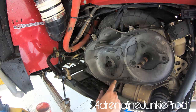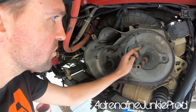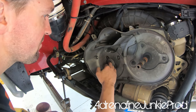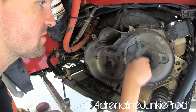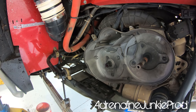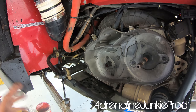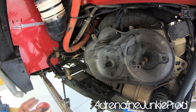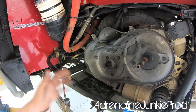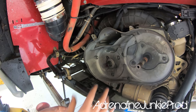Before moving to the bench, this is a good time to inspect the area. If there's any visible fresh oily residue or oil leaking out here, you need to replace those seals — mine look good. Check everything here, make sure the tapers are clean, wipe down the belt housing, and clean the inside of the belt cover. That way when you reassemble you know it's all clean and any debris found at the next inspection happened after this service.